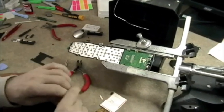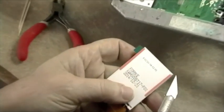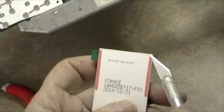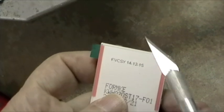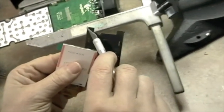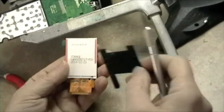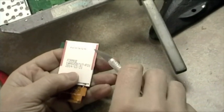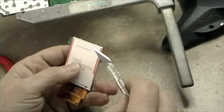Then we need to alter the module a little bit. There are two very small nibs at the top corners. These are typically used to go into guide holes on a mounting bracket so that it fits without having to eyeball it. You can see on the old bracket where they would have gone. But because this is not OEM size, it will not mount into those holes. So we need to remove these so that the double stick tape will sit flush with the bracket once we put the module on.